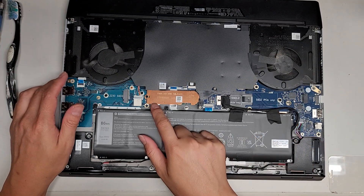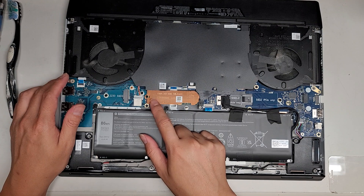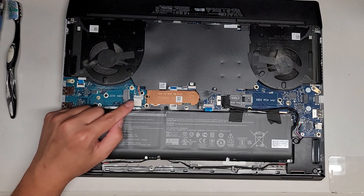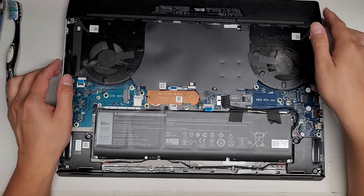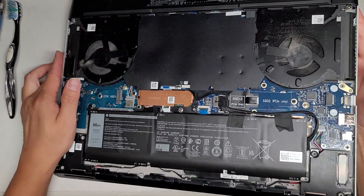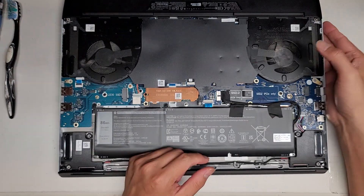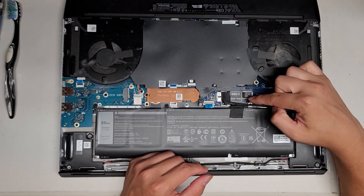You've got an M.2, I'm pretty sure it's a PCIe NVMe SSD. One screw comes up. The wireless card is soldered to the board. There's another M.2 PCIe SSD slot here - it even tells you PCIe only. So this laptop has room for another SSD.